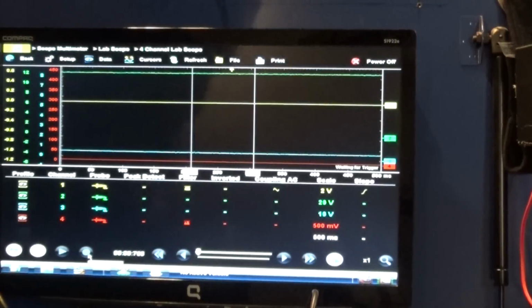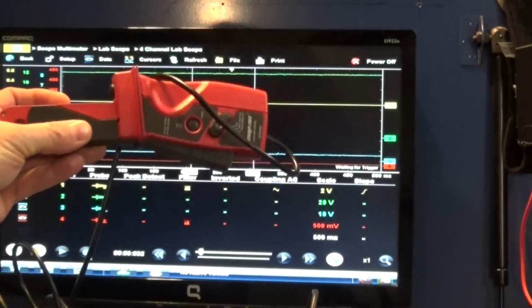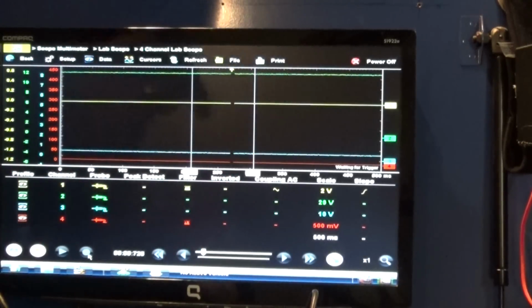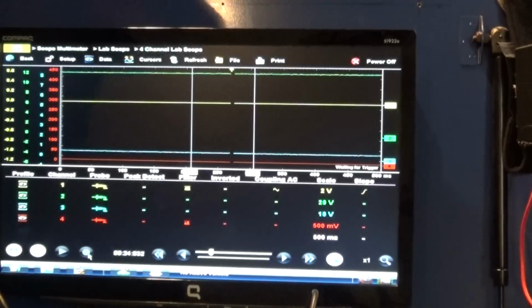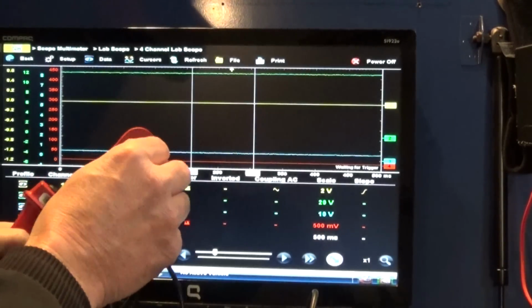Measure, you know, this one can measure up to 40 amps, and so as you can see, our amperage went all the way to about 200 amps. So in order to use this guy, we'll have to use AC coupling. Sometimes you might have a problem where the battery cable is too big. You cannot put it over the battery cable.